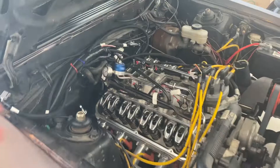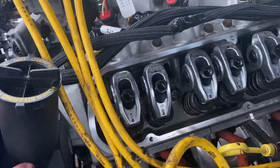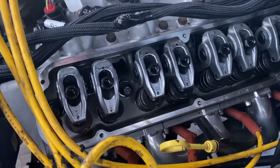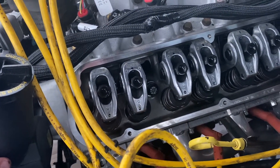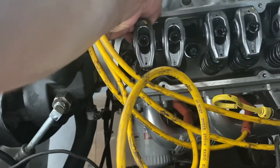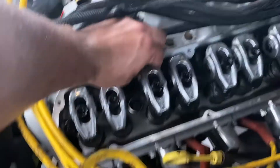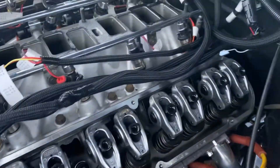All right, got the upper intake manifold and valve covers off. If you don't know the setup: these are Crane Cam 1.6 roller rockers, these are Blueprint Engines 190cc aluminum heads, and the cam is a Ford Racing F303 camshaft. Initial check — everything seems okay, nothing bent or anything. This is mainly just preventive maintenance because when I was last running it I was hearing a little bit of valve train noise. Most things seem okay, but — yeah, that one feels pretty loose, this one right here feels really loose.